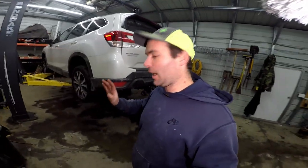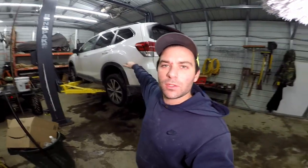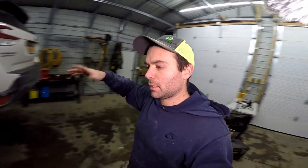All right, that is much better. Now if you're wondering why this might be happening — my concrete is actually not level. I have a floor drain in my concrete so the far side post is actually higher than the low side post. It's only by about an eighth of an inch, but that's where those leveling cables come in handy.